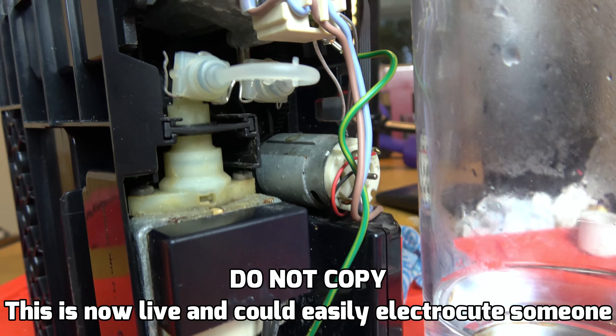You can buy these O-rings from places like eBay, and you can also buy replacement retaining clips from eBay as well. The retaining clips are back in - it's certainly not pretty, but let's see if it's still leaking. There's no water coming out from the bottom, and we've got water coming out here at the spout where it should be. Remember, I haven't got a capsule in it. Let's do that again - water's coming out and it doesn't appear to be leaking. So it looks like it was just the two O-rings.